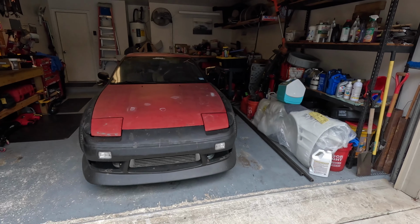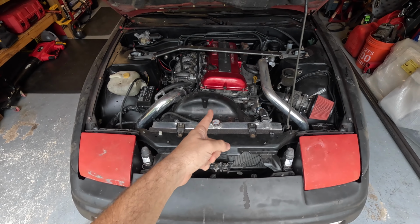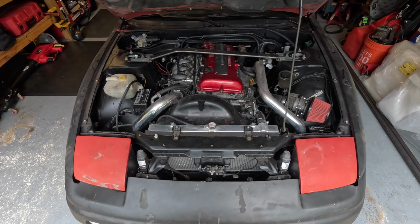Home, as you can see. Car is back in the garage in one piece. We still need to tear into this thing again. I'm pretty convinced that I just need to replace the lifter on the intake cam lobe for cylinder one and take a look at everything in there. I got a new timing chain tensioner as well.